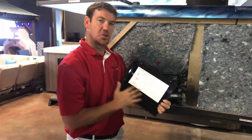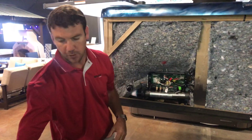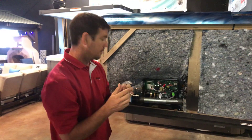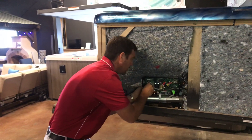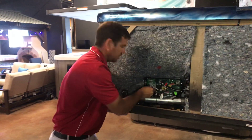Always read all the instructions and follow all the instructions on the back of that box — it tells you all the critical information. The next step involves a jumper wire on the back of that panel box. That wire will quickly and easily install on this model at J11 and J32. That is critical — that's what converts it over to 110.